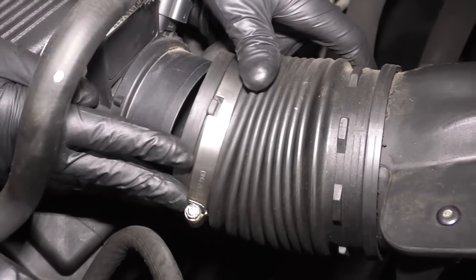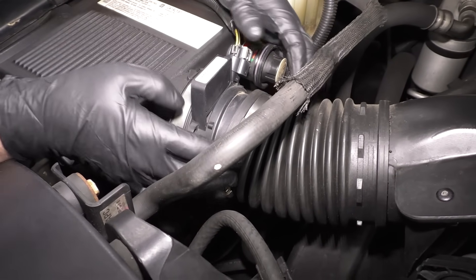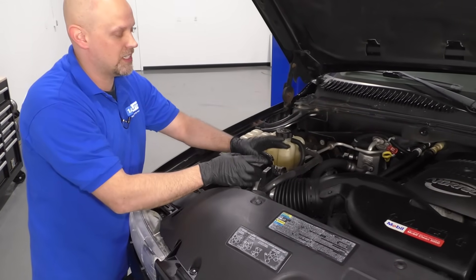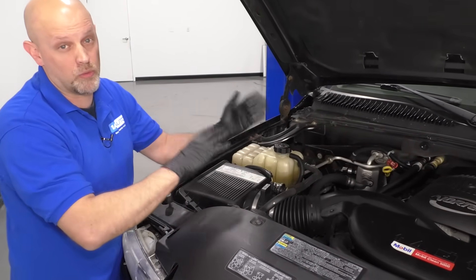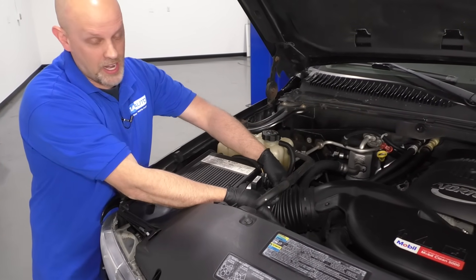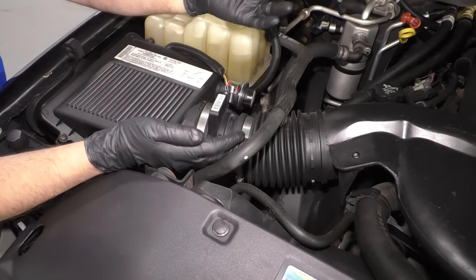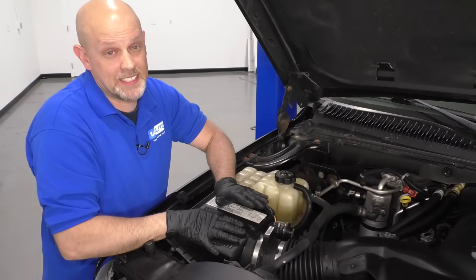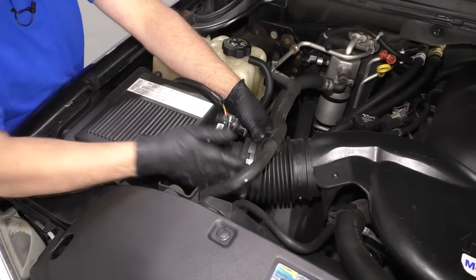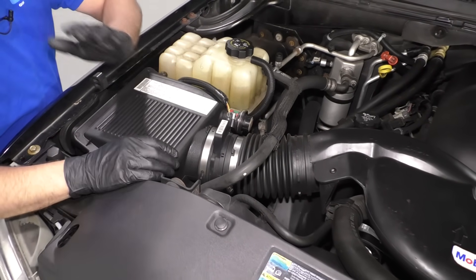If this is loose, that's not good. Near the air filter, you're going to have something called a mass airflow sensor. That's going to tell the computer how much air is getting into the engine, and the computer needs to know so that it can dump more fuel in or less fuel depending on that. But if you're getting extra air coming in through here, it's not measuring that air going in, so that's going to give you a code. You could have replaced the air filter and just forgot to tighten this up — it happens all the time. Anything loose like that, you just tighten it up, clear the code, and you'll be on your way.